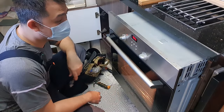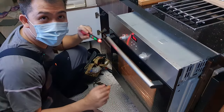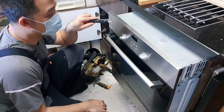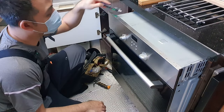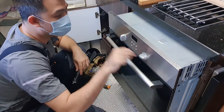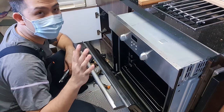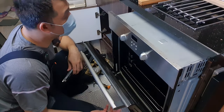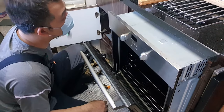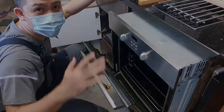We are back. The oven has been running at maximum power for the past 15 minutes and the case is still live, so now we are going to turn everything off. The first thing you want to do is turn it off at the wall if you have a wall switch. Check that the oven has been cut off from the power, switch off all the buttons, then open it and let it cool. It is very hot at this point — give it about 10 to 20 minutes to cool down before you pull it out and reconnect the ground wire. I am going to turn off the power at the circuit breaker and will be right back once everything is nice and cold.